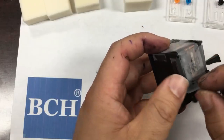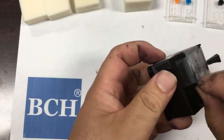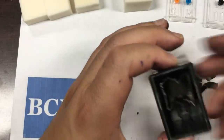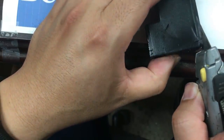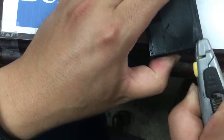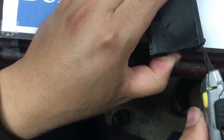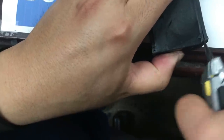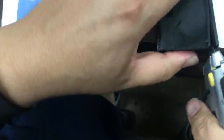Put it on the electronic ribbon. The third piece is in case there's some super glue drip down — we don't want the super glue to get on the electronic tape. If you want, you can bend the tape and make a little tab so it will be easier for you to remove it. Once the border is open, we'll work on the other sides. Once all the edges are loosened, the cap can be taken off and expose the sponge inside.